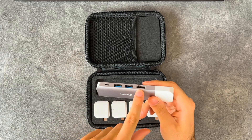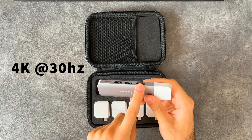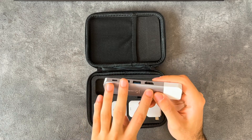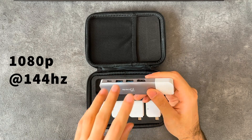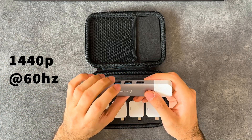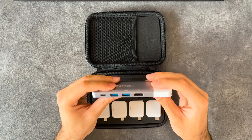You also get an HDMI 1.4 port here. Even though it doesn't state the standard on the box, it supports 4K at 30fps. Since 4K at 60fps requires HDMI 2.0, this is HDMI 1.4, which means the maximum refresh rate at 1080p is 144Hz. At 1440p I'd assume it's 60Hz, so: 4K at 30, 1440p at 60, and 1080p at 144Hz.